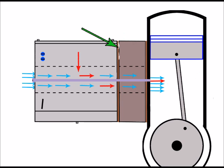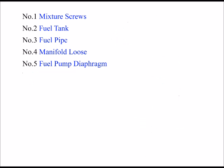And damage to the inlet manifold can be anywhere. So it's a case of having a really good look around the inlet manifold. If everything else you've checked is okay, and you've been through the processes so far, just take a good look at the inlet manifold. You can undo the main retaining screw and have a good look at the inlet manifold, and it's well worth doing so.